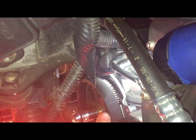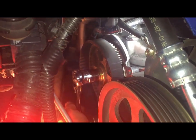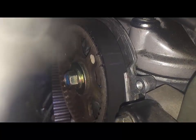So this on the back side cam, there is some tension in it, and it springs forward this whole sprocket. So what I need to do is make sure I line those 2 lines with the 2 notches. So you can see here, I'm gonna pull this because it sprung forward, until I kind of judge where the 2 notches are, and then start pushing the belt in to match those 2 marks on the sprocket. So the 2 marks line up. These 2 marks line up, and we know the bottom lines up.